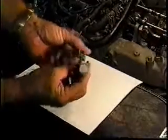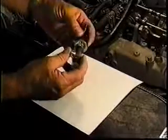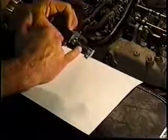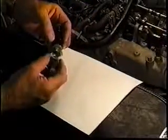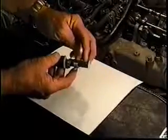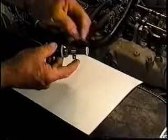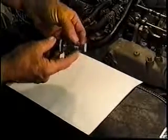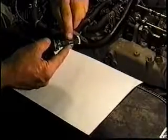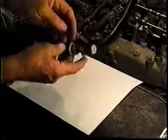This is a new clamp — it's not being clamped down. See how far open that is right now? There's a lot, almost out of threads on there. They'll move smoothly if they're open that far. This piece of line says Hyprex on it — that's the factory name. It's one of the fast ways to look and see if somebody's had problems with the injector hoses leaking, because all of the Nissan lines say Hyprex. The clamp itself has a little indication of its size: 13.5, and I assume that means 13.5 millimeter.